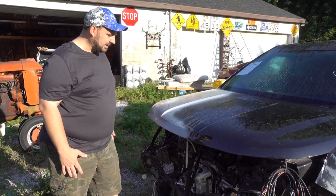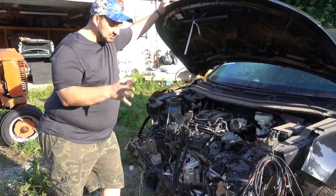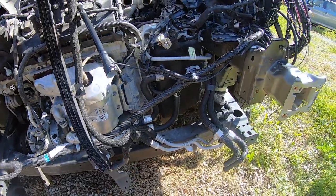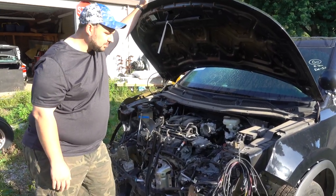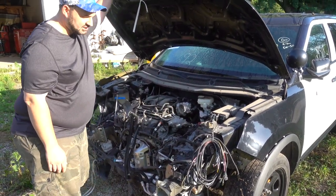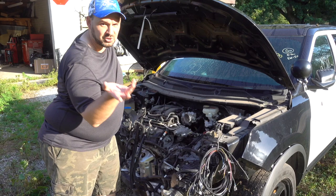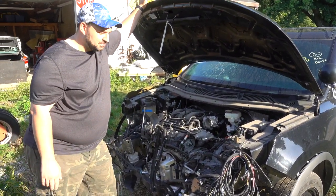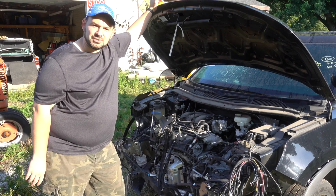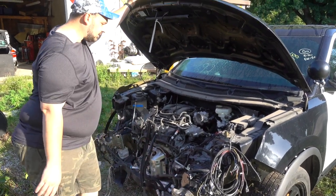Let's take a look at the front where the main damage is on this vehicle. Let's start on the driver's side where there's a little bit less going on. There's just a little bit of tweaking to the bracket on the end of the frame rail, but the frame rail is nice and straight — no big deal. Up here there's no damage, the fender is fine, and they've bundled up all the wiring. Interestingly, there's a lot of extra wiring in the Interceptor that Ford puts in from the factory, giving lots of options for adding lights, sirens, and so forth. As far as damage goes on this side, just a little bit at the end of the frame rail — no big deal.